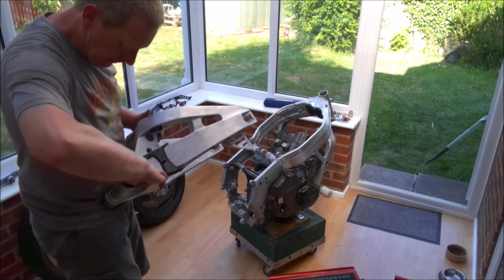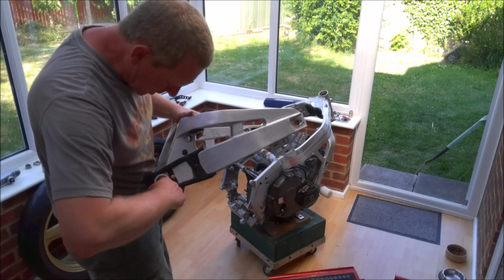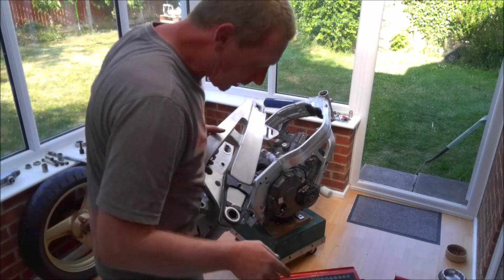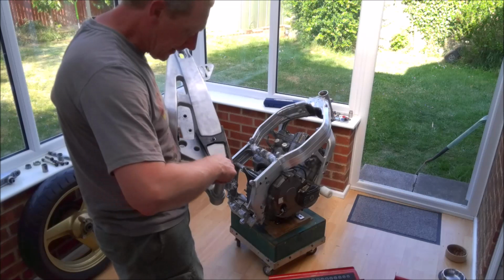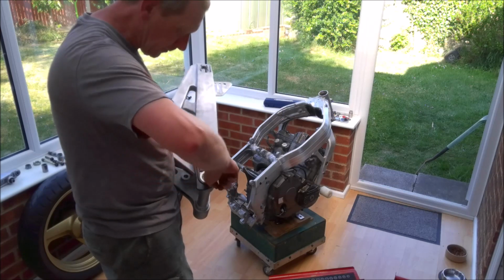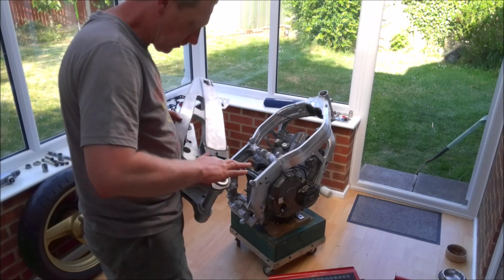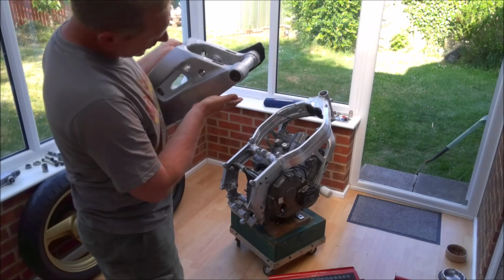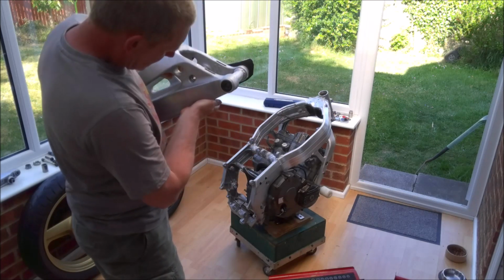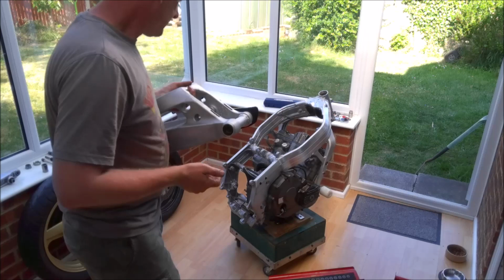And then I want to add some fresh grease around the rollers. So really you need to put it on your finger and push it into the actual bearing itself. Try and push the grease home. Now there's conventional roller bearings on the other side, and you can't really get into those to add any more grease. So they do feel pretty good actually.